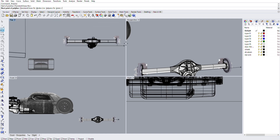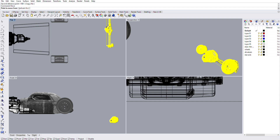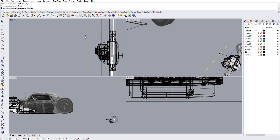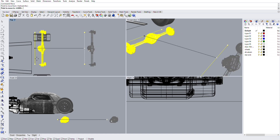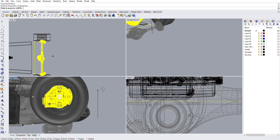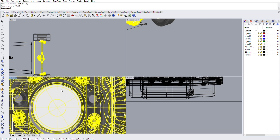It gives me something that represents what I would have in the back — not sure if I'm going to run a nine-inch, but it's a really good guideline. The axle was saved upside down, so I flipped it over. Just like on the rocker panels, I added a line from rotor to rotor to find the center line of the axle. I then moved everything — selecting it all at once — from that center line out to the center line I established between my rockers.